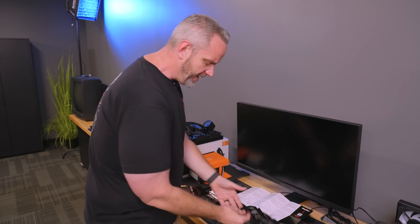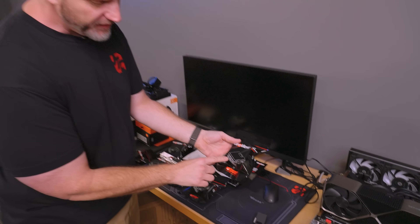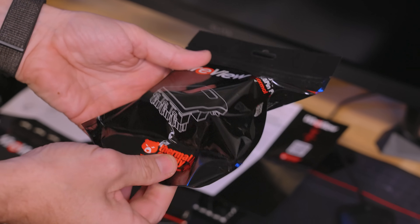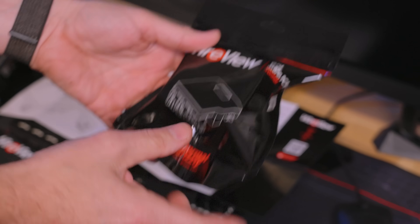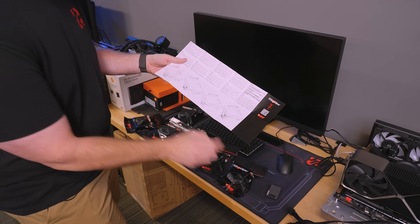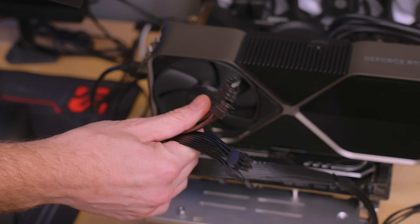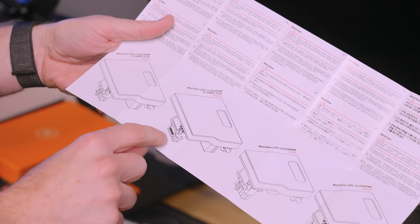The reason why there are so many versions is there are a lot of different configurations for graphics cards. This one uses three times PCI Express — so if you had an MSI card, EVGA card, or an Asus card that has three eight-pin connectors, that would plug directly into the card. They even have versions that convert from standard PCI Express plugs — your six-plus-two or eight-pin and six-pin — and then converts it to the 12-volt high-power plug for your 40 series graphics cards.